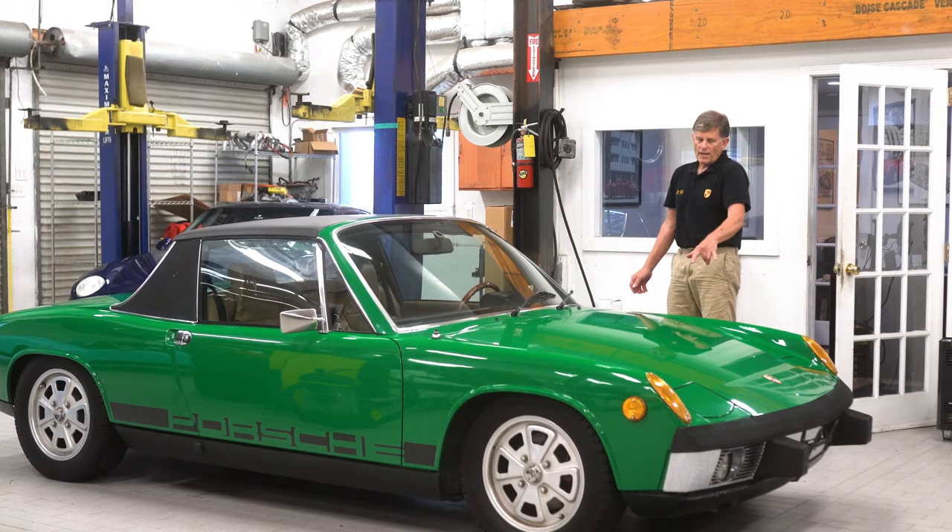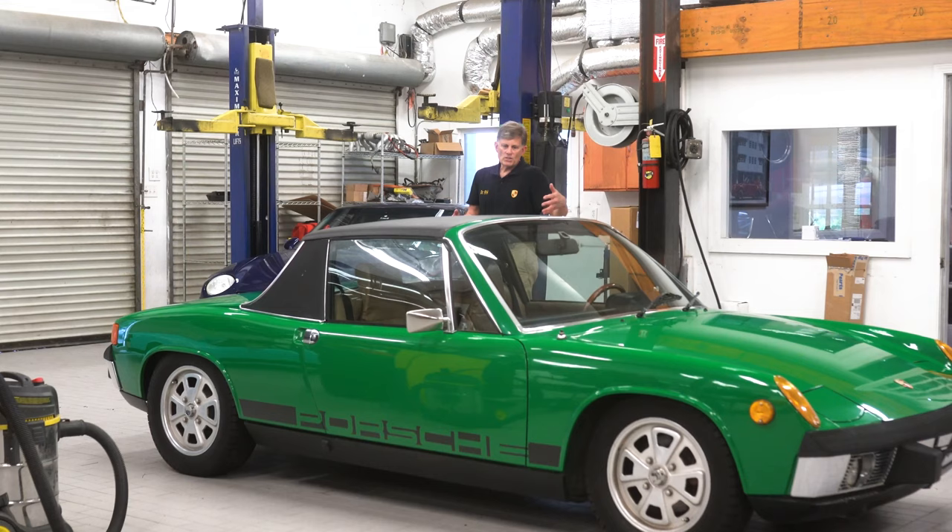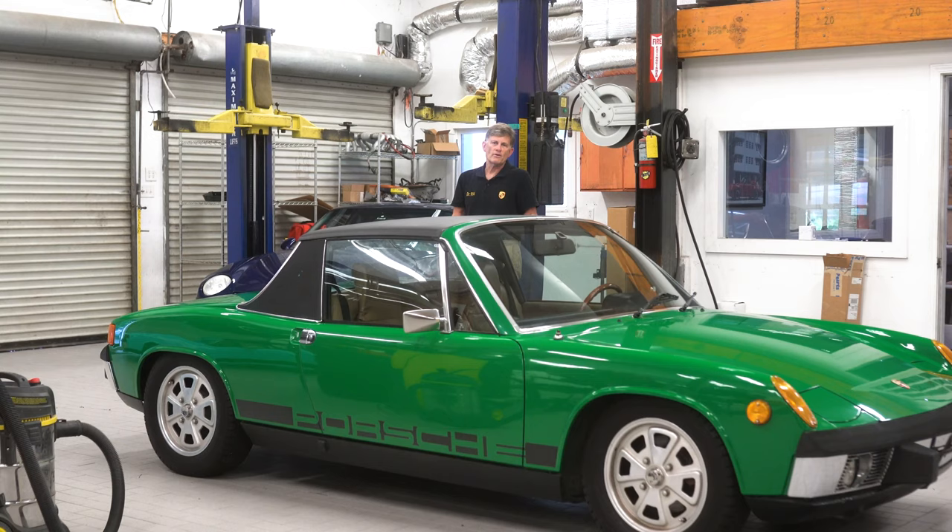In the rear, too many people have replaced springs with different kinds, which upsets the handling. For example, if somebody put 140-pound springs in with a rear sway bar, the car will go from handling neutrally to having the rear end come around in a corner — very dangerous. We want to make sure the car is in its factory original configuration. You can look under the car at the bottom of the rear shock bolt to see if a sway bar has been installed. In this case it has not, but there are white KYB shocks, which is why the rear is a little stiffer than the front.